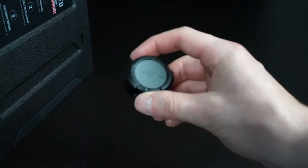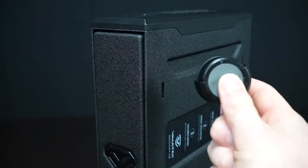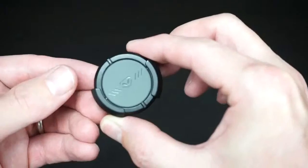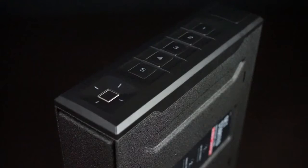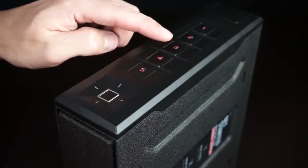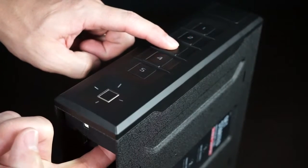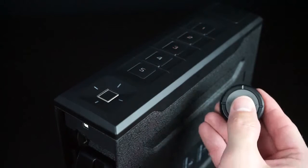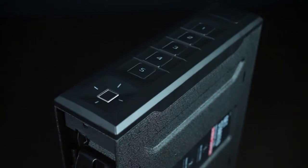SmartKey Nano is a great accessory for the slider series and sold separately. Its small size and simple function make it ideal for use as a hidden panic button. It can be mounted discreetly using the included peel and stick adhesive. To pair SmartKey, first open the safe and press and hold the three key followed by the program button together until all keys start blinking red. Aim your SmartKey towards the safe and press the button to pair. The keypad will light green confirming pairing is successful.